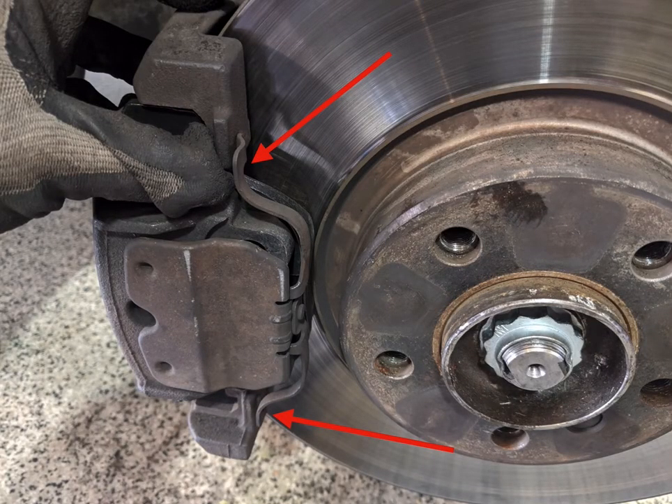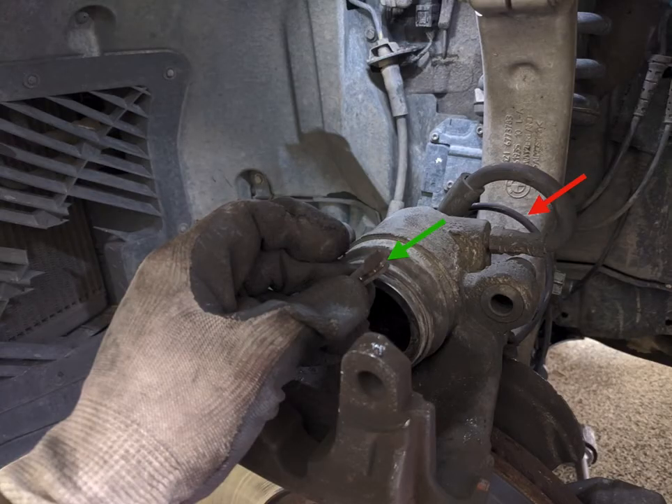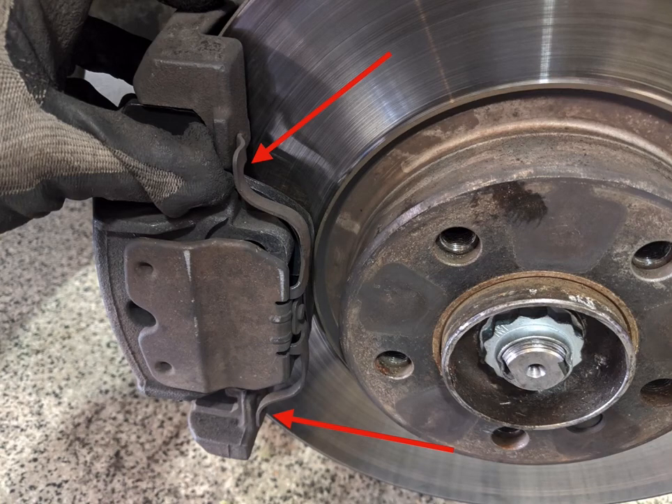Once you've done that, just put the new brake pads back in exactly how you pulled the old ones out. You can see I've got the new brake pads on and I'm putting the retaining pin back in. You set it in the two little guides on the back, and then you have to pry each one of those little tensioner springs — the arrows are pointing to them — one at a time over to the front, and then you'll get tension on it and it'll be retained. Of course you put the T45 Torx guide bolts back in and tighten those down.